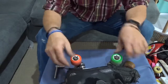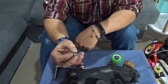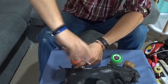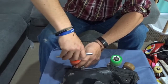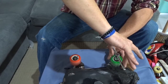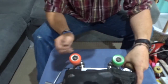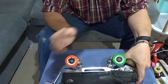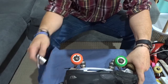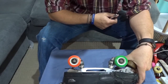So we've got our wheel nuts — start it on there. You'll notice at the top of your wheel nut there is a nylon insert around the top side, and then the bottom is flat. The flat side goes down to the wheel, and the nylon's on the outside to hold your nut on there and stop it falling off. Once we've got them started, put our tool on there and screw them down. Make sure you're not cross-threading it, make sure it's going down nice and square. We want to get them nice and snug on the wheel but not over tight — what we don't want to do is over-tighten it. So once you feel it start to bite up, stop there. We don't want to over-tighten because we will crush our bearings and they're not going to spin. If your wheels are too tight, they're going to spin maybe half a turn, quarter of a turn — not going very far. When we get to that, we just want to get our wheel tool and back it off about half a turn until your wheels spin freely.